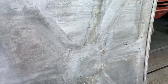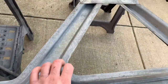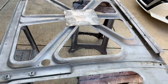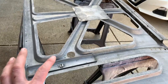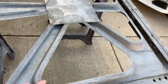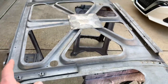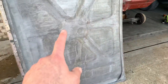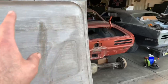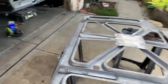That would have caused blistering and bubbling in the new paint job. The inner frame looks fantastic — it came out great. I wish the top came out as good as the frame did. This has all been acid dip treated and neutralized, but the next step is to get the paint to stick. It needs to be scuffed or sanded so the paint will adhere. I plan to hit all this with a self-etching primer, both the inside of this and the inside of that, then get prepped to put the two pieces back together.